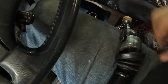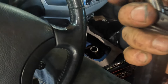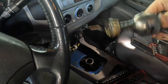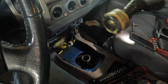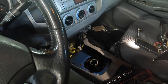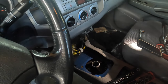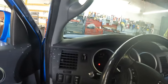What you do is actually pull up on this rubber piece, and then there's this little cap — push in and rotate it counterclockwise. There's a little pin down in there and that's what it latches into. You can pull the shifter out. There is your bushing right there — we're going to replace that because it does have a good bit of slop in the shifter. I'm gonna set this down outside for the time being so nothing gets dirty.